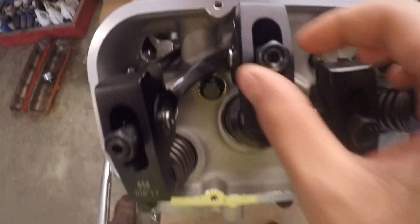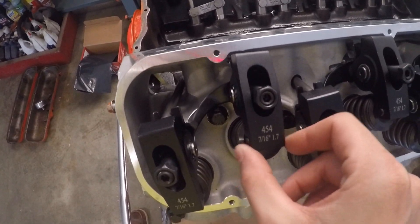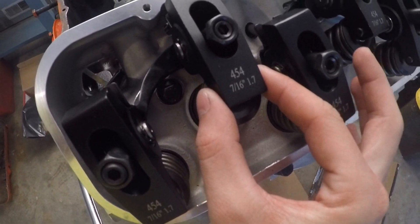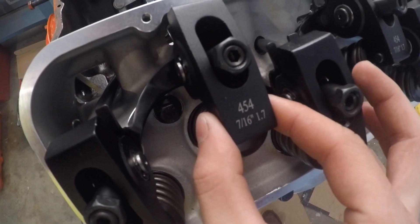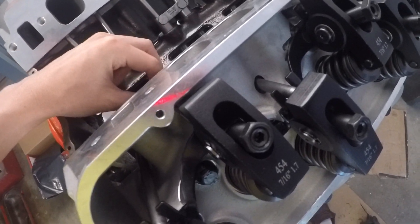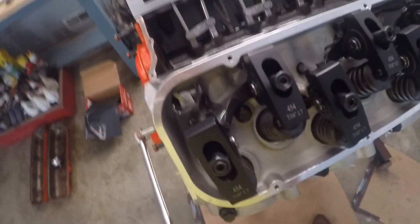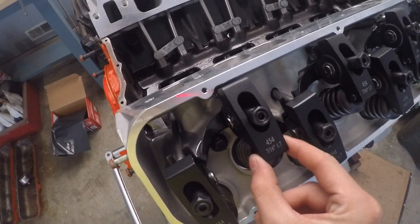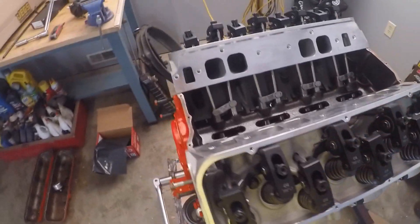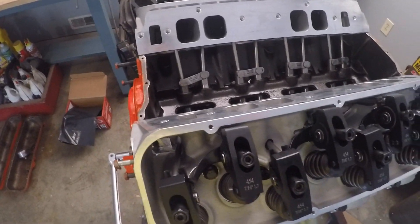Our polylock is all the way ran out — that's that Allen key there in the middle. Take the nut, get us a little bit of lash, and then slowly tighten it in. I'm just very lightly grabbing the back and lifting it up — you'll feel that play in there. You want to get just to zero lash, a little bit at a time. There's no up and down play in the rocker anymore. There's a whole method on twisting the push rod, but to me that's kind of a bad way because there's no way to gauge the drag besides experience. This way it's foolproof — zero play.